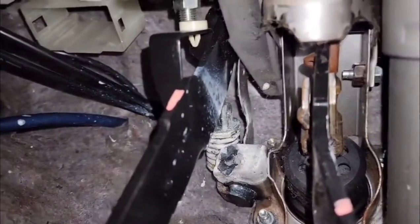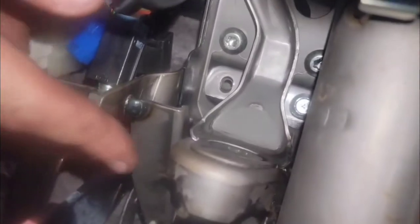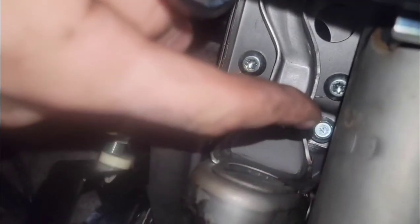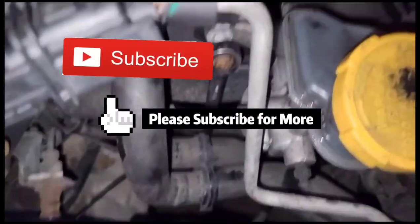I've got the pin out for the brake and took the pin out for the clutch. You don't necessarily have to take the pin out where the clutch pedal is, but I did. I'll look at the assembly again because it comes with a whole new spring and everything. All the bolts are 12mm — right there, right there, all around there — and then through the firewall the whole clutch assembly should come out. To get the last two bolts free you've got to take the clutch pedal out completely and use a small ratchet. Both those nuts are 12s — break those two free and the whole clutch assembly kit will just come out.